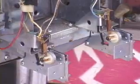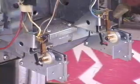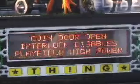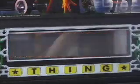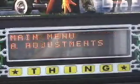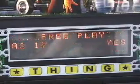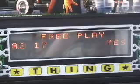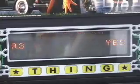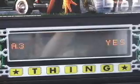So again, I'd rather have a tech or somebody you know that's familiar with pinball set the game up for you for free play if it is not that way already. On a lot of these 90s games, if you can navigate through the diagnostic menus in these newer games, a lot of times you can change the pricing to free play, like right here. So that way you can set the game to free play without doing any modifications to the exterior and without adding any buttons.